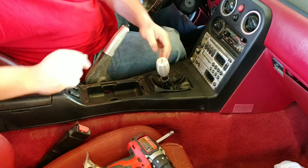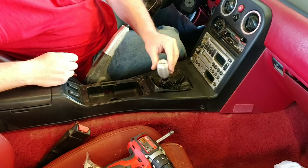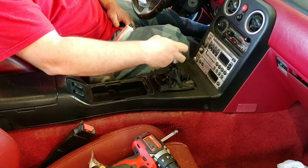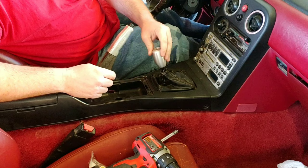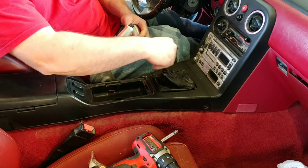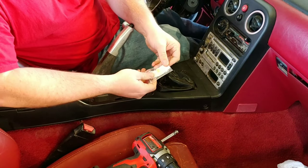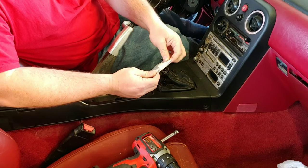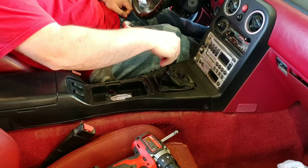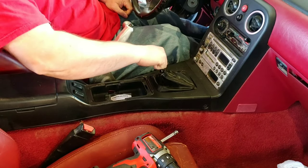What's going on? Today I'm gonna fix what's been a problem for a long time. See this? Let's put it in another gear — put the clutch in. So here it is in second gear, and there's that much wobble. That problem is this little piece right here — it's a shifter bushing. I'm gonna go ahead and change that today because that's annoying, that'd be annoying for anyone. Here's neutral — it has as much play in neutral as it does in gear.